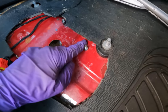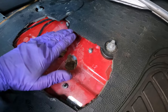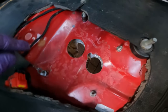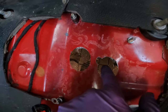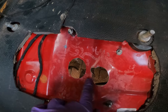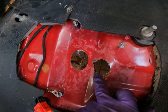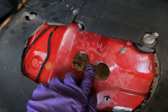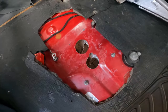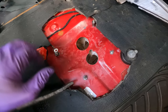Because of the shape of the bodywork, there's a 20mm spacer and a 6mm spacer, and two of them just have nuts. So when the plate sits on, the base plate is now flush all the way along. I drilled the holes with a hole cutter — right the way through for both main holes, and those two holes are roughly in line. I also had to put a small hole for the fuel fill and fuel supply to the actual heater, as you can see on the bottom of the plate. Those are the main holes you need to drill into the floor pan of the van.